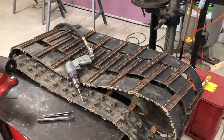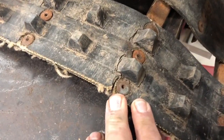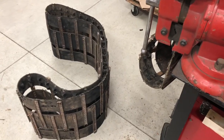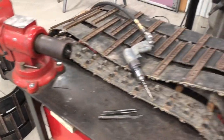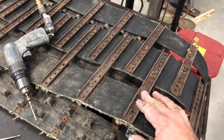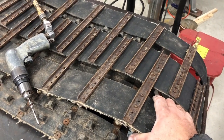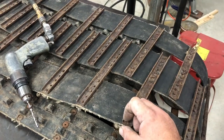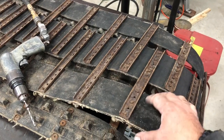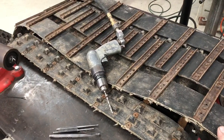As I've talked about tracks before, I'm faced with a dilemma. This track here is pretty beat up — the belting is starting to give way, but it's got the better cleats. This track here, the cleats are trashed but the belts are in fair shape. So I'm faced with several hours of misery drilling out all these rivets. Instead of drilling out 450 rivets times two, I'm going to take the outer belts off one and exchange them, leaving the middle ones. We're in for a fair amount of misery here, folks. Pitter-patter.